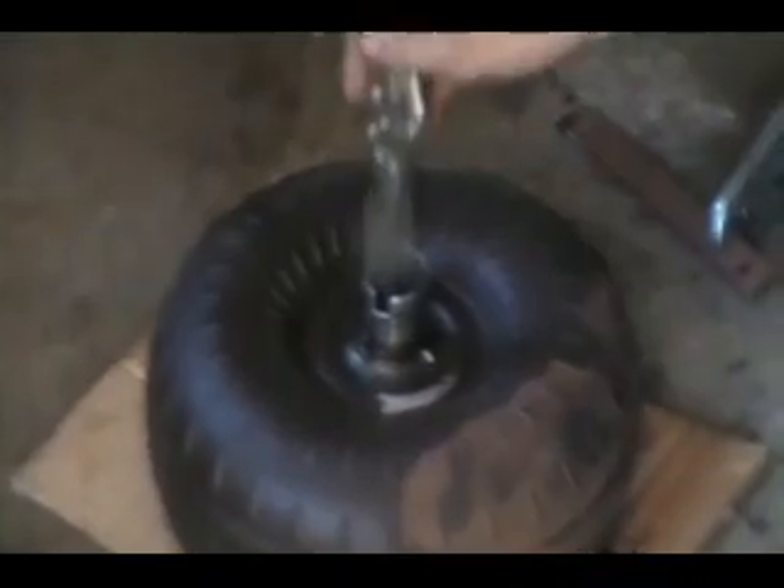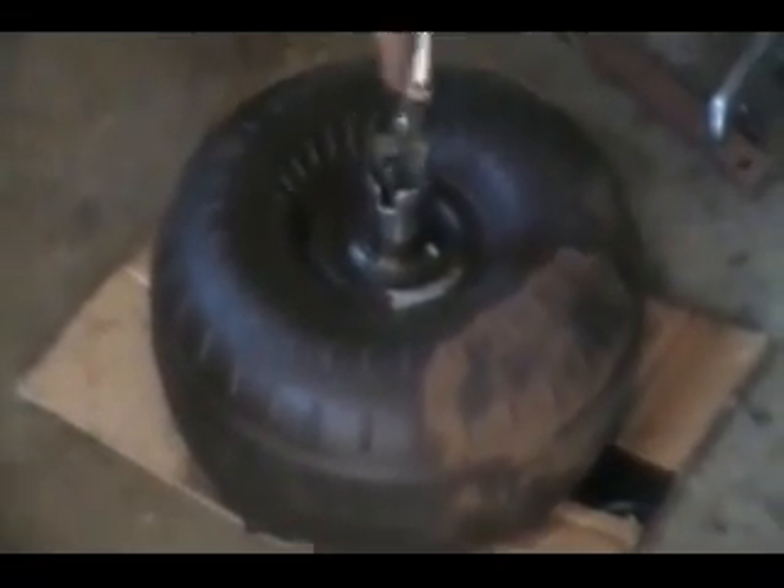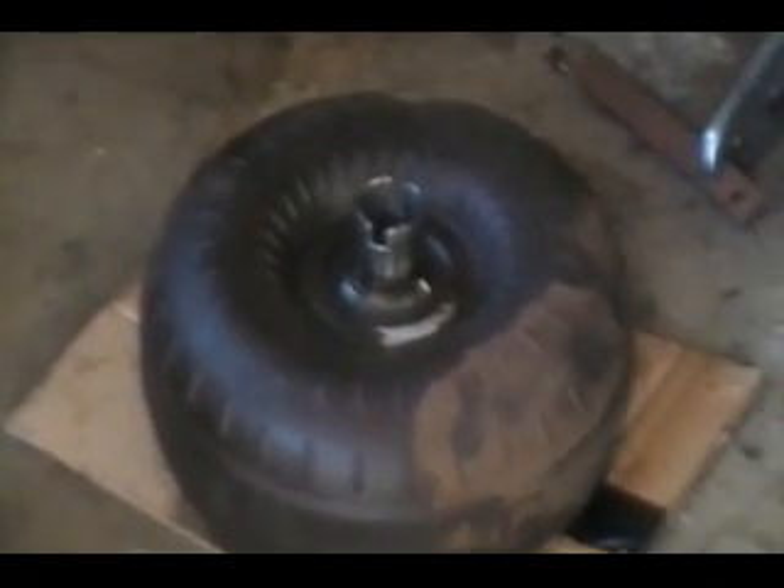However, the stator — the bigger shaft, the one that goes on this bigger shaft of the transmission — that appears to have no resistance in either direction when turned. This stator clutch is supposed to offer some resistance when turned counter-clockwise. This could be the source of the horrific noise that we heard in the first video. So I'm going to buy another converter and install it and see what happens.